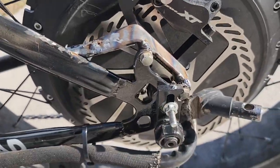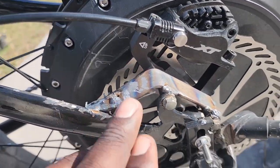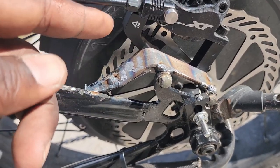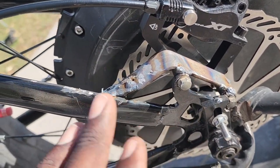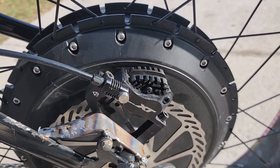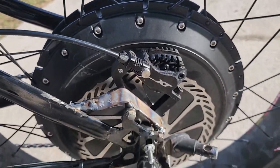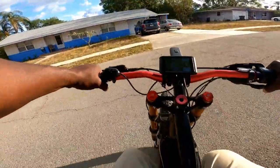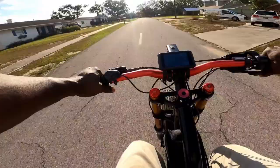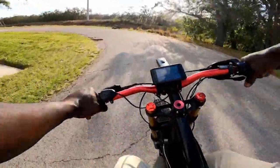Here's my little contraption — I welded a piece of bar right here and bent it over, attaching it to the frame. I'm going to smooth this out, paint it, take the caliper and bracket off, cover the rotor, and paint over everything so it looks a little neater. So far so good — I tested the brakes and there's nowhere near as much flex as there used to be. We're going to go ahead and test it down the road and see how it works. There's a lot of rubbing going on but I guarantee they're stopping a lot better.